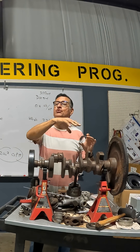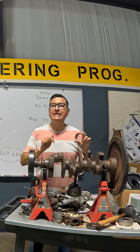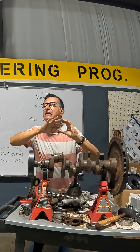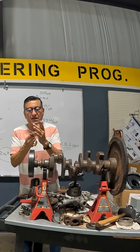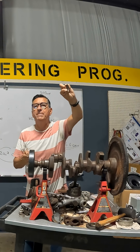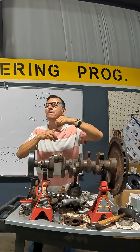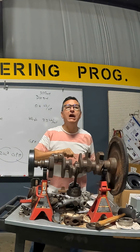Suppose that you use oil not appropriate for this engine and that oil allows this soft metal to deteriorate — it's gone. The soft metal, the white metal, disappeared and was melted, and now it's pure metal. What happened in between this and this? Too much play. And what happened with the oil pressure on the gauge? It goes down.